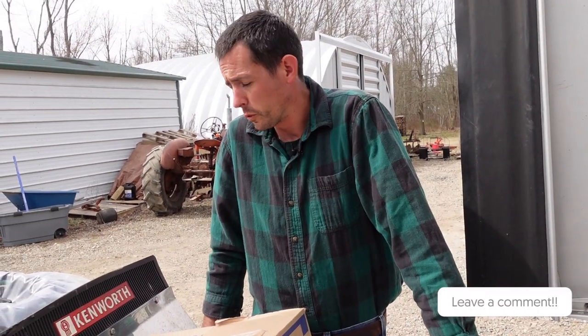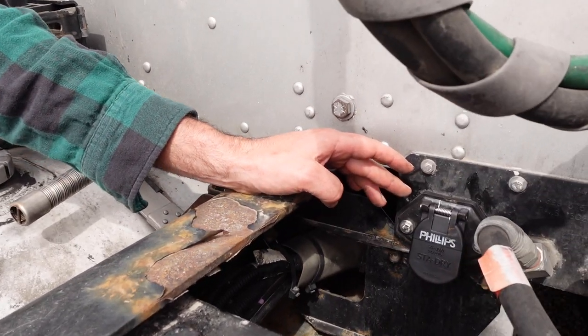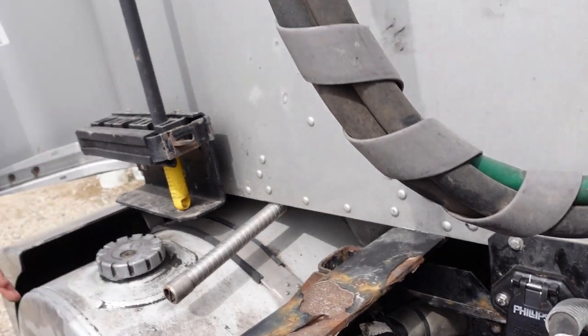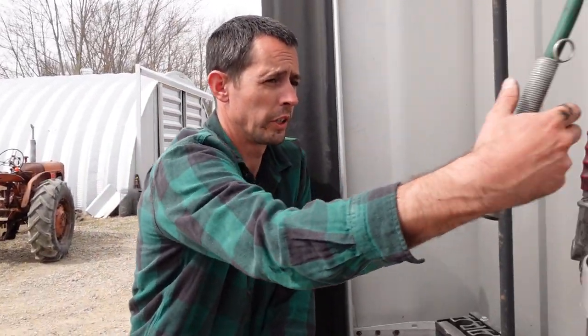I'm not going to bore you guys with that — I'm going to do that here a little bit later. But we've got that in, and like I say, if you're having issues with your trailer wiring and it's not your pigtail, then mostly it's either in the trailer somewhere, or in that little harness, or in your chassis harness. Because this little jumper harness we just put on is the final stop before your chassis harness. Chassis harnesses — that's the whole wire harness for the whole truck — they can get pretty expensive, or you'll have to find where it's messed up and fix it there. But in my case, and probably in a lot of other people's cases, it's probably right there in that socket on that cannon plug where you're having your problems. So if you've got a Kenworth like this and you're having those issues, check that thing out first, or after you try a pigtail, because sometimes those go bad as well.